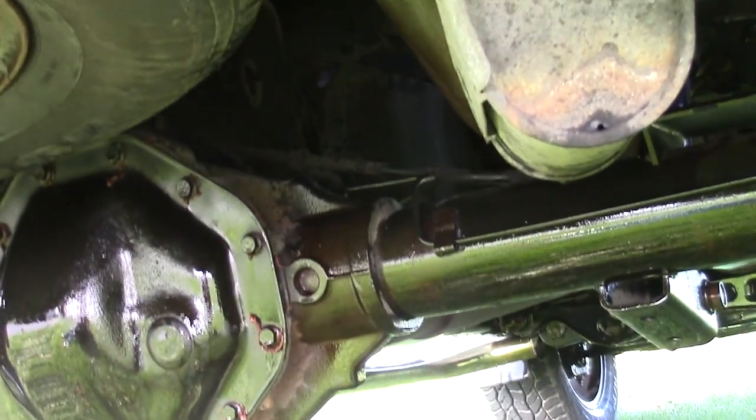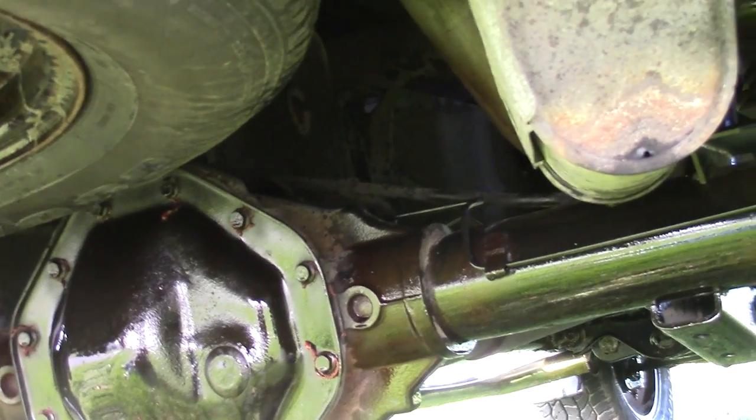This thing's probably going to drip for a day or so, and obviously if you thin it with 10W30, it's going to drip more than if you just use bar and chain oil. But the gun worked real well, and things covered very well. And as I mentioned, and Musty One mentioned it in his video, you really got to try and stay off the rubber, because the rubber will swell and end up cracking from the different oil products.